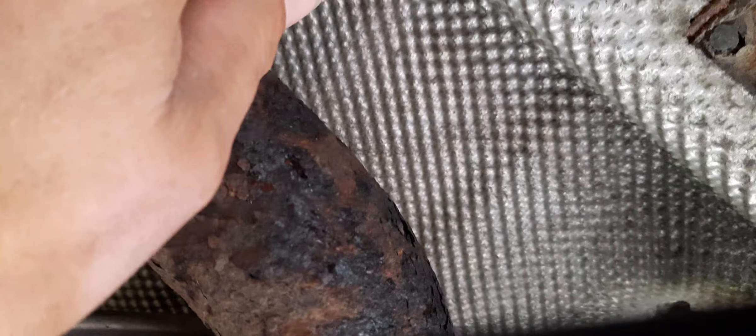This mount is very, very corroded. As a simple fix, if we wanted to budget it, my suggestion would be to replace all bolts, which look knackered — completely rotten. That's going to be quite a good job. The chassis is getting a bit scabby. We're doing some shot-blasting, cleaning up with a soft disc, and maybe a bit of welding may be required.